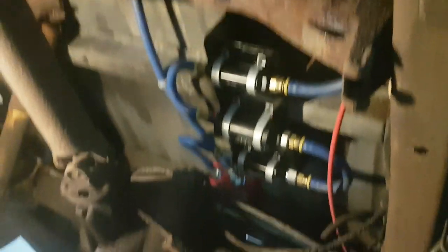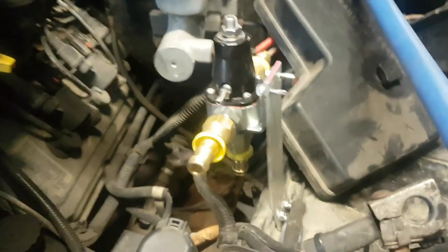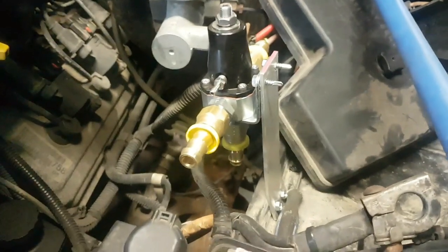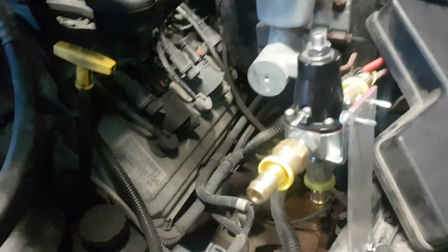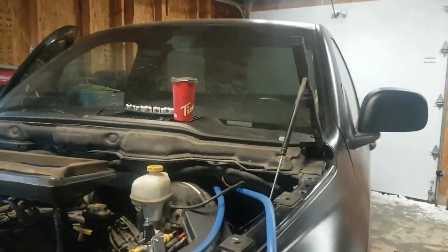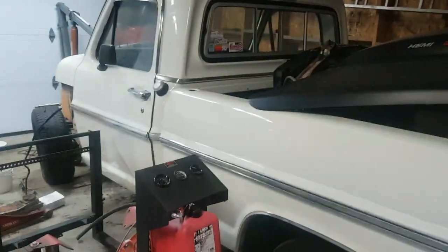We do need to tie up that red battery cable, but we've got all the fuel lines where we want them and secured down. Up at the front here is our regulator — we're not set on that position yet, we just want to get it in place somewhere we can get things connected. Here are our feed and return lines. We still need a short piece to go to the fuel rail — we ran out of hose and also needed a fitting to go from AN to the fuel line. We've taken the hood off and are going to remove the hinges and just run hood pins.